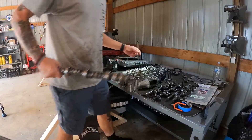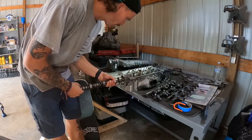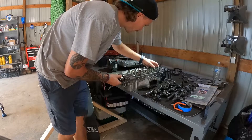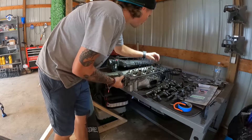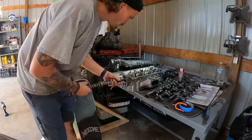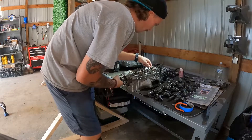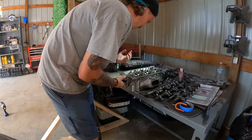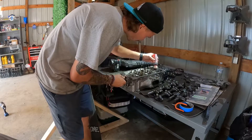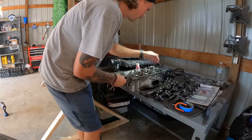So I've got my head here and I'm going to go ahead and slide the cam in — making sure it's facing the right way. This is the J35 cam going into the J32 head. Wait, this is the wrong cam — this one belongs in the other head. I'm going to grab the other cam. There might be a way to tell which cam goes to which head, but honestly I have no idea other than putting it in, realizing it doesn't line up, and grabbing the other one. Before I slide it all the way in, I'm going to get my assembly lube and make sure we've got a good amount on it so it can rotate nice and easy, because there's no oil in here anywhere.